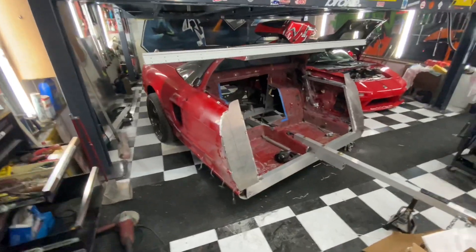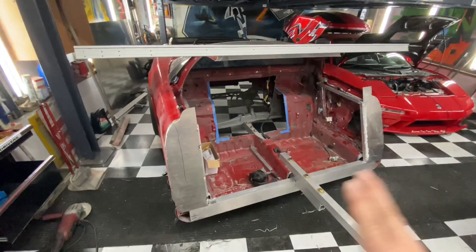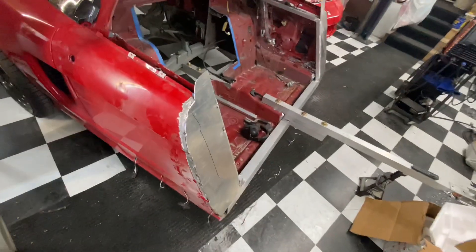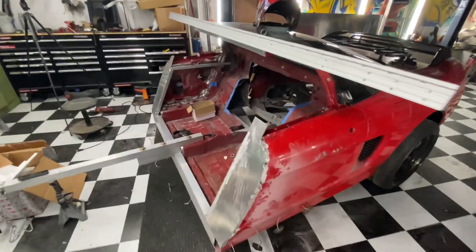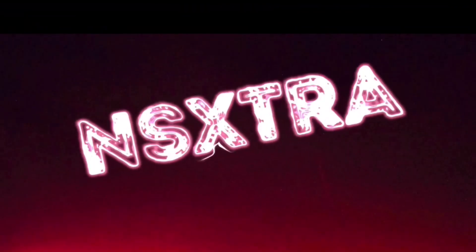There it is. Originally I was thinking I'd cut the same contours as the doors to get it on, but now I'm thinking that's kind of unnecessary — I can just have the door sitting there. It might not be as attractive on the front, but it'll save weight, and that's one of my concerns right now. With these capped off, I'm happy. I'll have to do some filler work, grind all the tacks down so it's smooth, then paint the doors and blend everything in. It's coming along — I'm pumped, light at the end of the tunnel. Thanks for watching and for the support — don't forget to like, comment, and subscribe. I try to release a video every week.